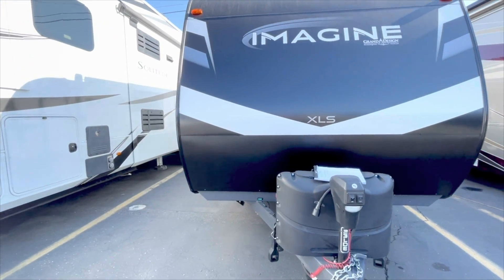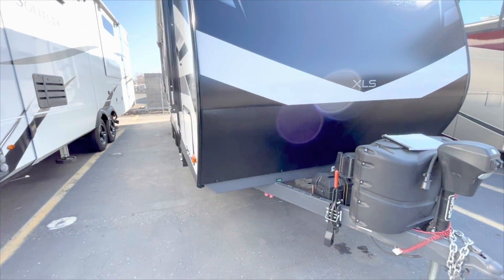I'm walking around the coach and it's actually in really good shape. I did notice they used a different frame design on this year compared to some of the others we've been seeing. One of the things we're looking at now that it's winter is the age of the sealant. You can see how yellowed this sealant is around the clearance lights. I've walked around the coach and found lots of little bubbles, pockets, voids, and gaps — things that aren't secured tight enough against the coach. Look at the corner here, how tight my finger is compared to the center — little gaps in the sealants.